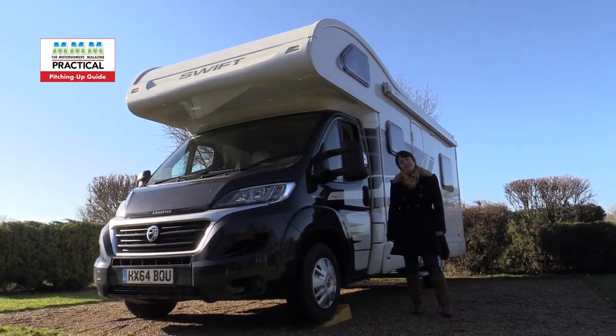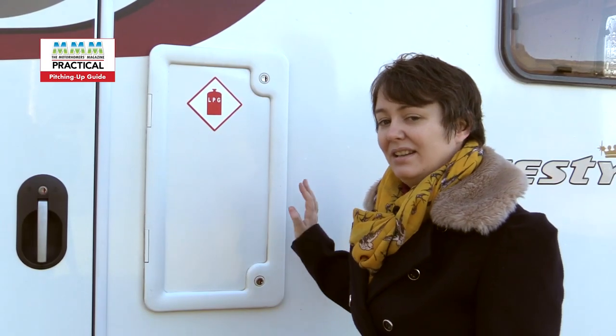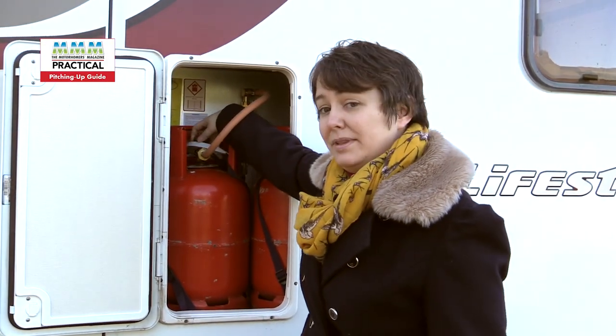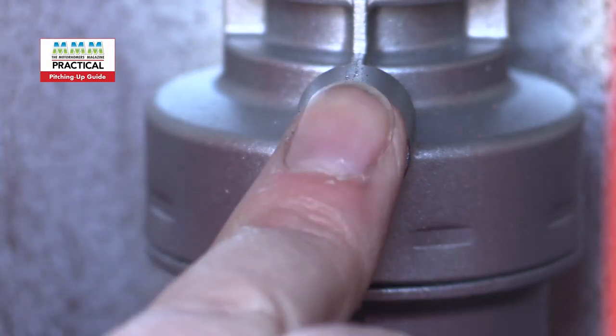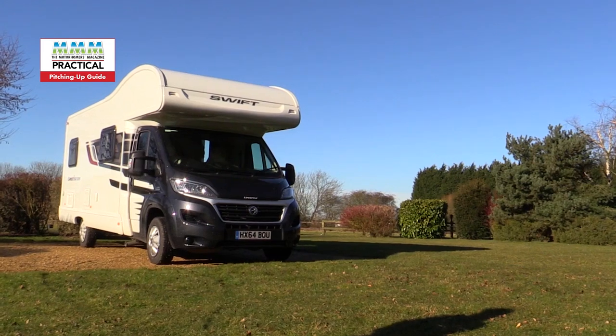It's time to move on to the next step. One of the first steps is to turn the gas on. It's in a locker outside the motorhome — simply open the door and there's one or two cylinders in there. You just swivel the dial at the top of the cylinder until it's in the fully up position. If gas isn't actually feeding into the motorhome, there is a pressure release valve here — just press that for a few seconds and then you're good to go.